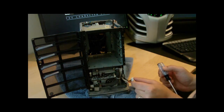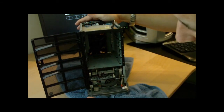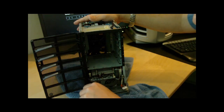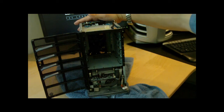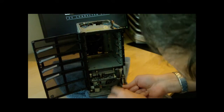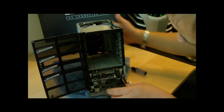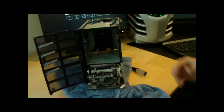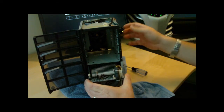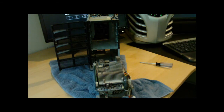The other one is behind the cable on the right, a little bit in the back - that's the power supply side. You won't have to take the motherboard off the power supply, which is a good thing. It's a pretty tight fit - the heat sink on the CPU is practically touching the drive cage with only a couple millimeters of clearance. You'll start to wiggle that out; it'll be a tough fit. The power unit is connected to the motherboard via this plate and the whole thing comes out as a unit. Take it all the way out - it's heavy, like a tugboat.